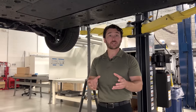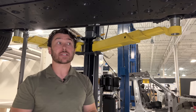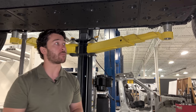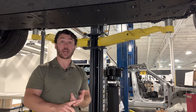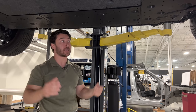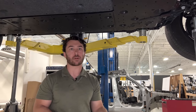So within those extrusion cells, even going to the outboard sides where we meet against the pinch weld for the body, we see a very high level of integration with this, which is supported by some of the images that we'll have provided. They are capturing spaces for the brake lines running fore and aft in part of the cell in the extrusion on the outboard sides of the pack, as well as what we have with many other packs, such as the 4680 Model Y pack, for instance.